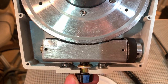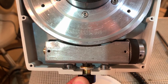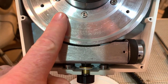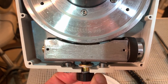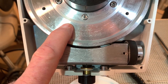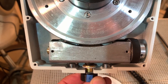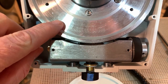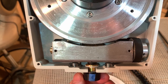If I turn it about another quarter to a third of a turn, right about there, it starts to open up. I'm going to close it again just so you can see that — it just barely starts to open up, but there's still really no discernible play in there. So if you go about another third of a turn, you can tell that the gears are just starting to separate because there's a little bit of play. And now there's quite a discernible bit of play in the gears.